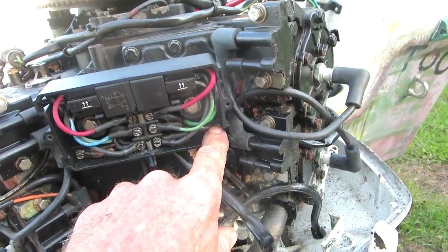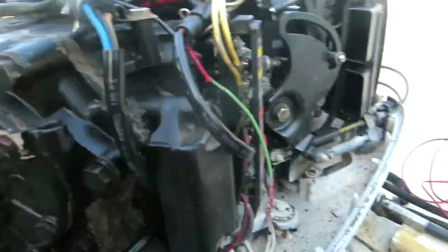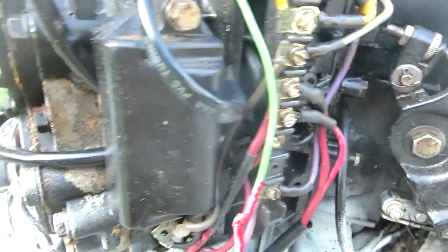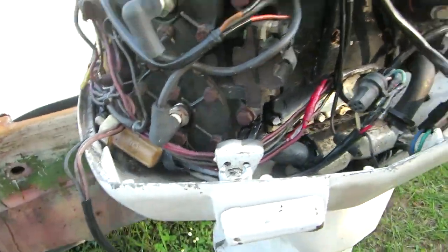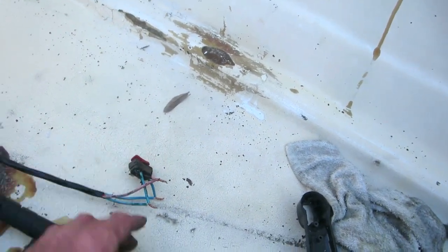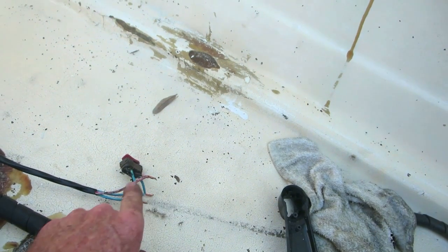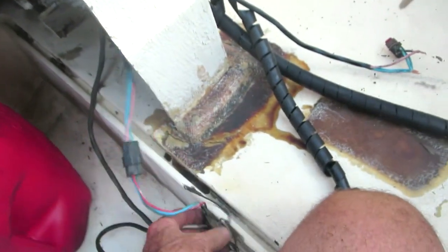Basically what you're looking for: you want 12 volts — in my case 12.41 volts — at those two terminals. They're strapped together so you should have 12 volts at both. Those come from over here. Once you get into the switch area and you're checking things, 12 volts at the center red wire, which switches these two leads — make sure you've got power coming through that connector.